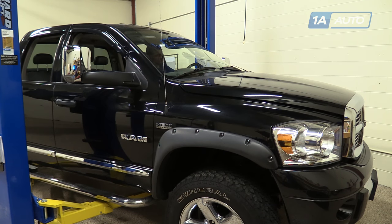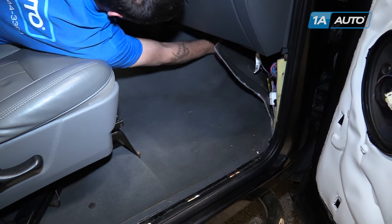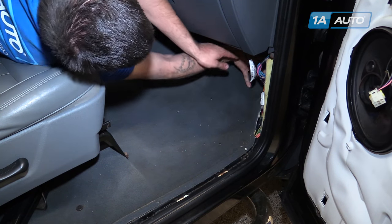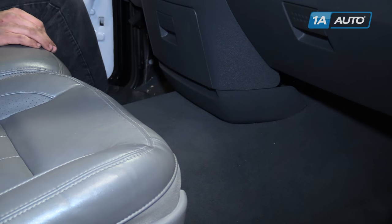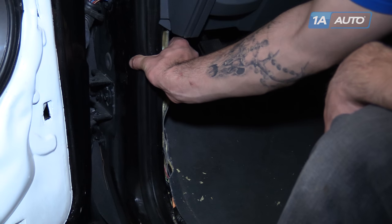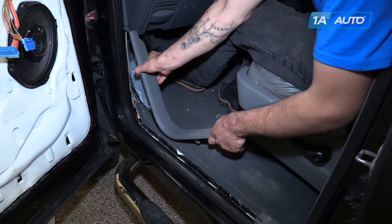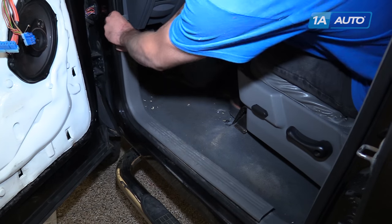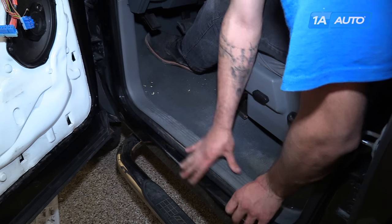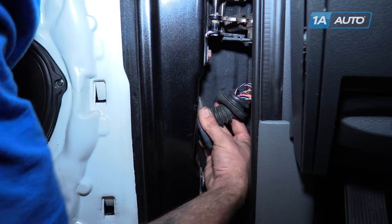After installing your wiring, turn the vehicle on and check for operation of your running lights. Push your carpet back into place. Reinstall the trim below the cup holder. Put the two clips in the front. Reinstall the plastic connectors. Hold the weather shield in. Make sure your carpet's back in place. Install the front clips of the kick panel, then snap the lower portion into place. Repeat this step on the opposite side. Reinstall the rubber wire loom on both sides.